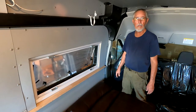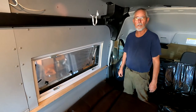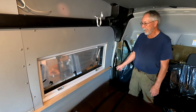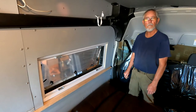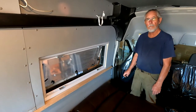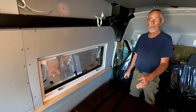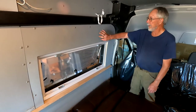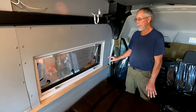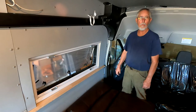Of course, when you use lacquer thinner, you always want to take care of your solvent-soaked rags — they go in a special metal container so we don't have any problems with a possible fire. It'll clean that right off. I've seen fires started from spontaneous combustion from things like that kept improperly. Also, on this panel we made black marks with a marking pen — those come off with alcohol. It's an easy thing, doesn't change any of the surface, and removes all the black marks.